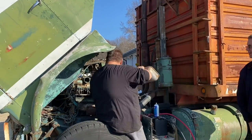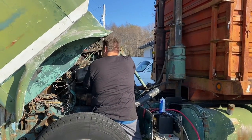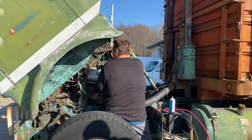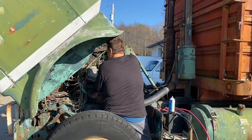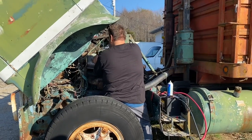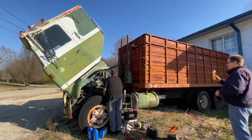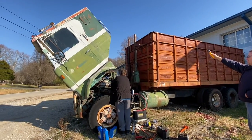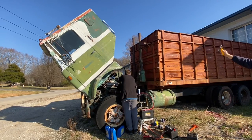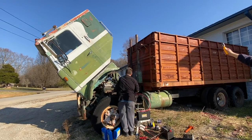All right. Cover your side? Yeah. Did you shut it down? I was being very conservative with the fuel. Okay. It made noise when I was happy, but I didn't want to let it just take off. If you don't see any oil coming out of the rockers in about 10 seconds, go ahead and shut it down, all right? Okay. Here we go. Give it a little juice.